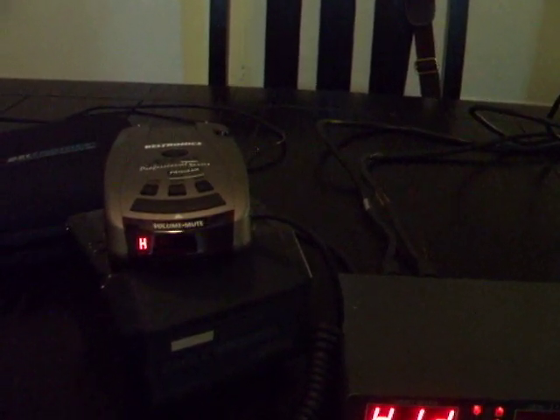Let's start off with the front antenna, KA. The detector right now is set up in international mode, sweeping the entire KA band bandwidth — I believe that's 2.6 GHz — which is a rather wide band to sweep. It takes some time to get through all those frequencies. When we switch to USA mode, it's going to just focus on the frequencies used here in the U.S.: 33.8, which is MPH Industries radars; 34.7, which is Stalker radar; and 35.5, which is Custom Signals and Decatur radar units. With USA mode selected, it really cuts down on the bandwidth that this detector has to sweep. So let's see what effect it has.